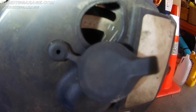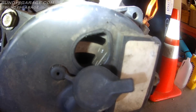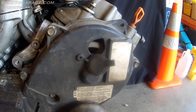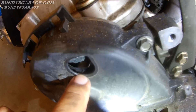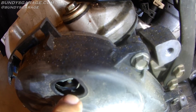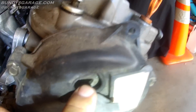There are six cylinders on this engine so the numbers go one through six. You have to rotate the crank to bring the cams into alignment, and you want number one to appear on the front. So right down there at the bottom there is a little mark on the plastic — a raised indentation — and that will actually line up with the number.